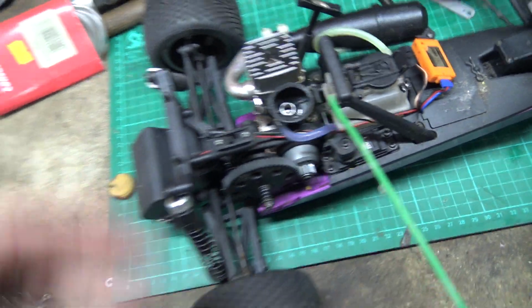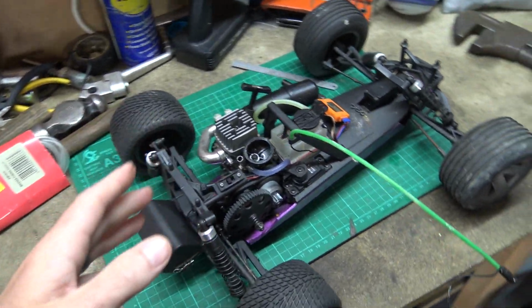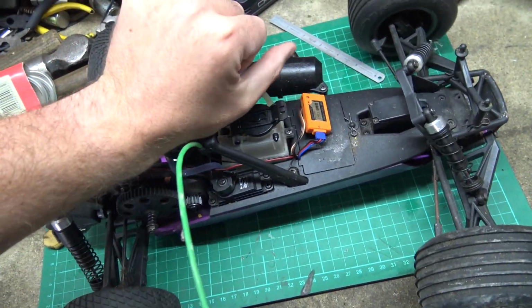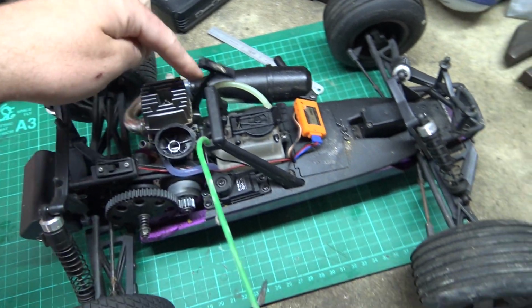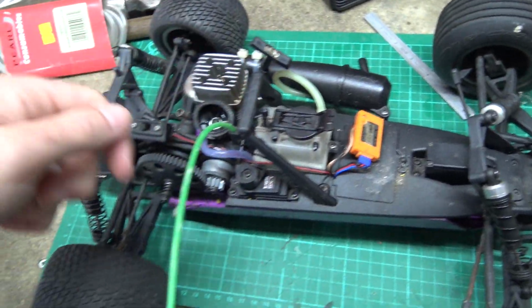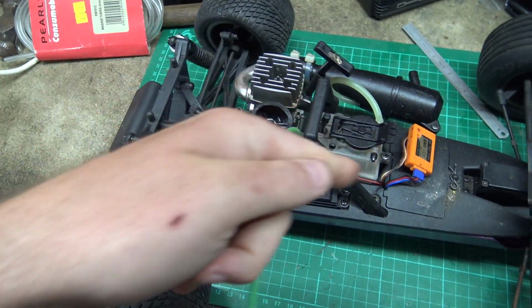But anyway, there's not a lot else really to do. So, to recap in a simpler version, hopefully: if you've got an engine that won't start, like this person on the Instagram messages, check to make sure you've got enough compression. Make sure it feels good. You can't hear any hissing, psst, psst, every time you pull the engine over. You've not got any leaks around here. These four bolts are tight. Take your fuel pipe off the exhaust part, take it off of here and blow through this side and hold this little tube out. Make sure you've got fuel coming out.